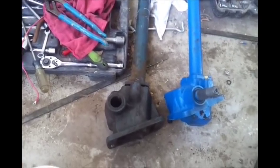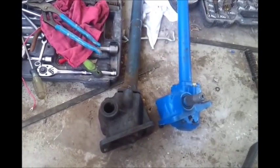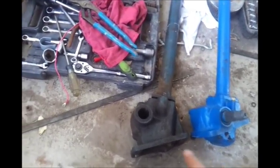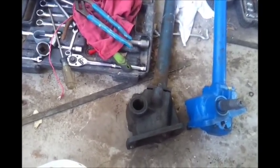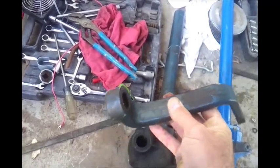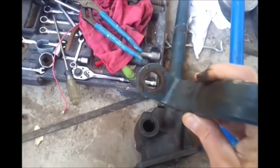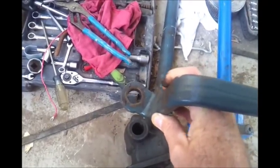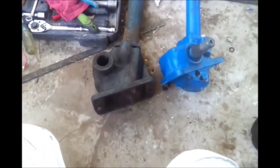This is a brand new steering box for a 245 DT or 245 L245, and this is the original steering box for the L295. The DT has an arm that looks like this for both models — the 245 and the 295 — except the hole size is larger on the 295 on both ends. You could probably use one of these, but you're going to have to re-drill the other side. The steering box itself will bolt right up.